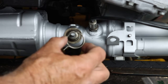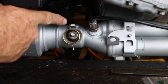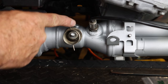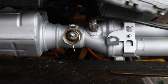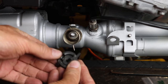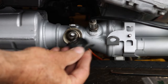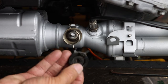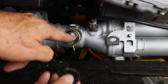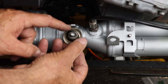So how this works is you put the spring on, and you want to put the spring on so that the top of the spring, and this is in the back position, rests on this tab, the left hand side of that tab. And then what you're going to do is the two holes for the cable sections that grab onto the cable will be all the way to your left position. So you want to find your little spring holder. Notice the position of the butterfly valve here.